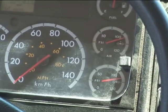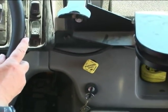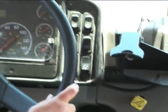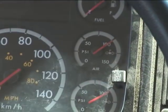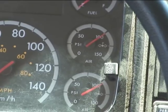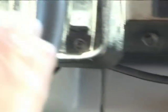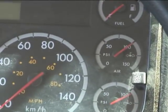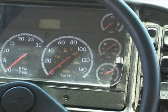Now we're going to do air loss rate. Engine off, spring brake off — push it in. Then you're going to step on the brake right to the floor and make sure that your pressure is over 90. Then you're going to time it for one minute. Minute's gone by, spring brake on. Air loss rate is good — the needle did not move. If it lost more than 3 PSI in one minute, it would be defective.